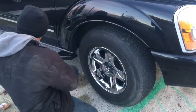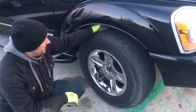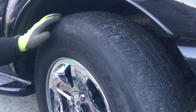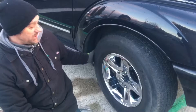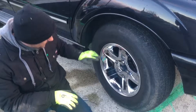You'll want to locate on the tire the indicator that shows the safe operating range for air pressure. Generally it's 44 psi these days, though some older cars will have 35 to 37. This one happens to be 44. Press the gauge firmly, hold it on, and give it a couple of seconds. As we can see, this one's a tad low — reads about 35.